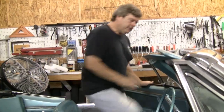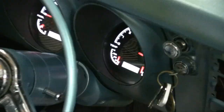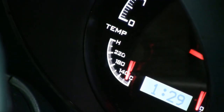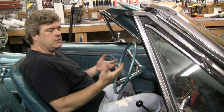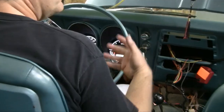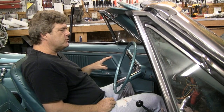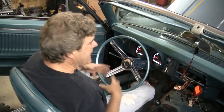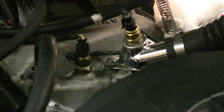We've talked about the pulleys, now we're going to talk about gauges. This car has in it a set of Dakota Digital gauges - it's a fairly accurate gauge set. What I would recommend is getting yourself a digital thermometer and testing your sender. Most of the senders sent out now for these type of gauges are fairly accurate. Stuff like the Dakota Digital sending units are really nice.